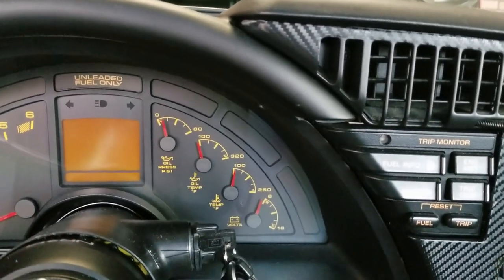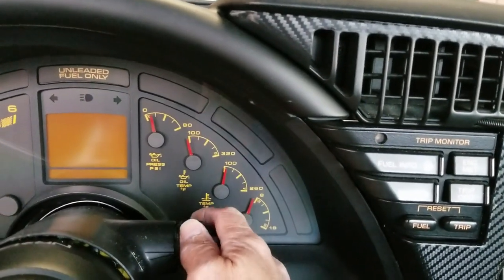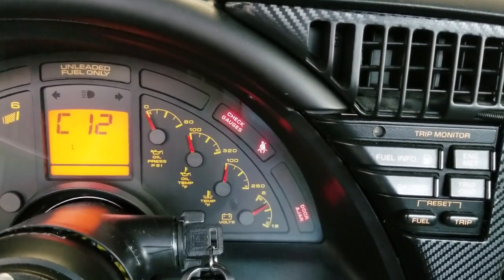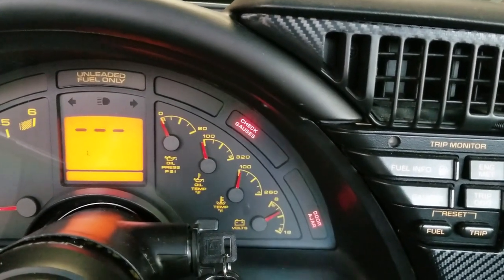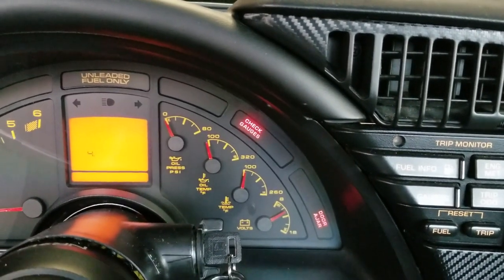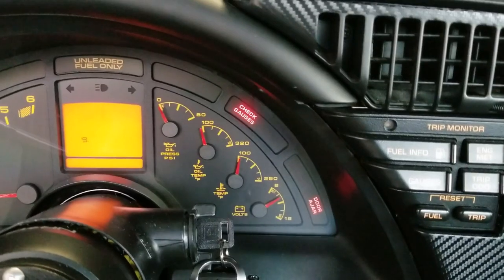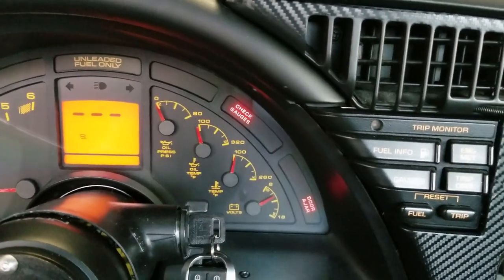So once we've got the jumper set down below with the paper clip, you're going to come up here and turn the key on. You're going to see that it's going to go into diagnostic mode and it's going to report a C12, and then there's a line below that. That's if there's nothing in that particular section of the computer — you'll see the three lines. Then you go to the next one and it has an H16 code, which I will tell you about in a second. It's cycling through all of its different computers and that's going to be the only one that it finds.